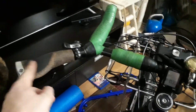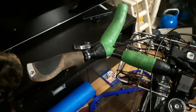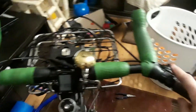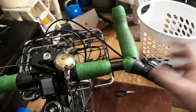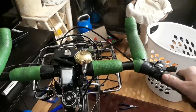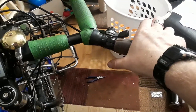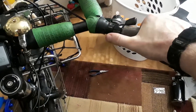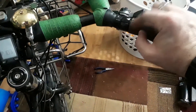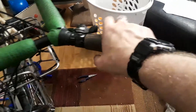I actually cut a centimeter off on each side because it just felt too wide and ungainly for me. I was only limited in how much I cut off by where my shifting levers and brake levers had to install. Velo Orange's website actually says you can cut off pieces of the end. I probably could cut even more if I was willing to have my grip here a little shorter — just cut off the extra cork space and move the lever in, then cut off the extra handlebar end to make everything flush and work.